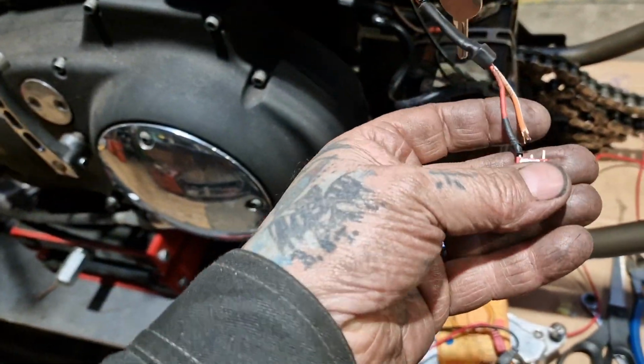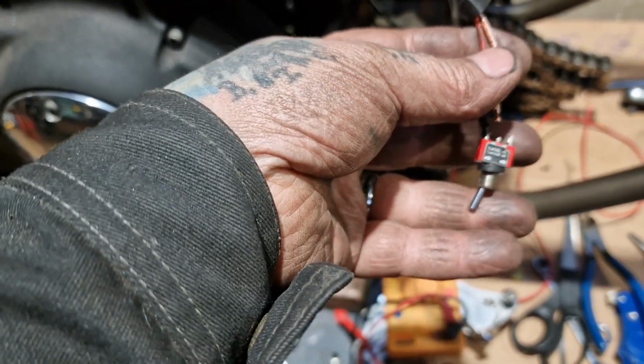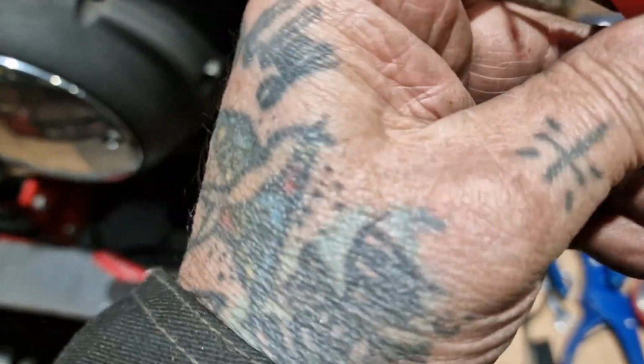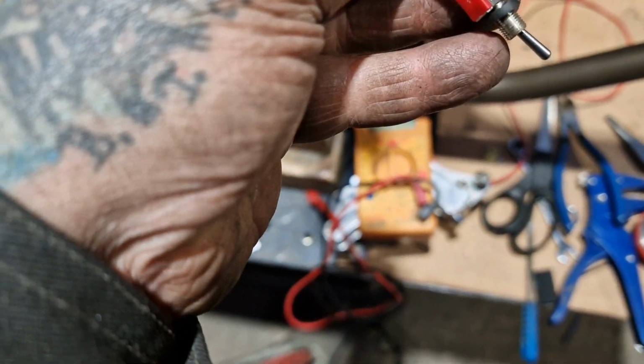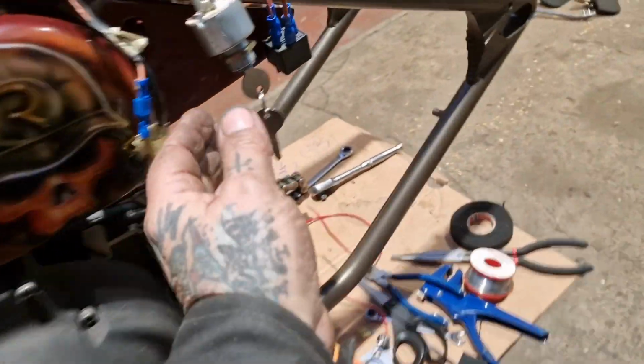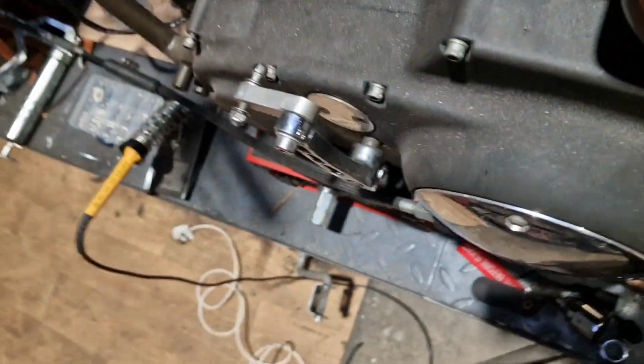And I'm happy to announce that we have lights. Look, again, if we hotwire this switch, fucking hell, steady. If we hotwire this switch, we'll just flick it, like so. You can hear the solenoid. Listen, that's the solenoid. Did you hear that? That goes, and we have lights. And I've checked the handlebar switch. Works this, which is a latching relay. So you tap it once, low beam, tap it again, high beam, and there she stays like. So just turn this off.